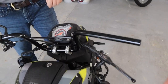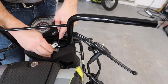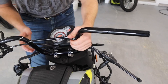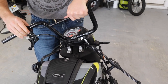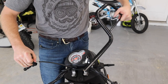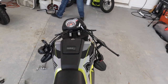Got the four bolts off — go ahead and remove them. Just so y'all are aware, there is a little cable guide bracket that sits on top, so just lift that up, the top's off. Give it a little wiggle and pull off, then slide the handlebar section off. When you put these on the new handlebars, obviously you have to slide this section onto the handlebars before you put the handlebars into the mount. That was probably less than 10 minutes.